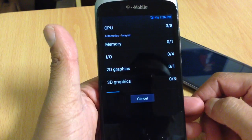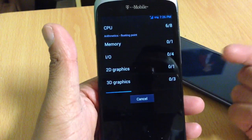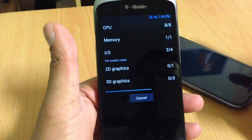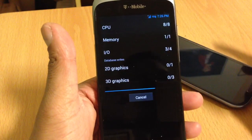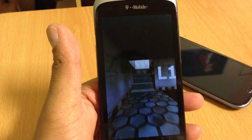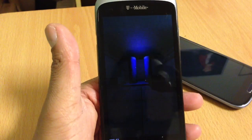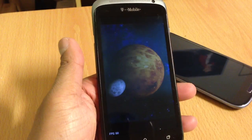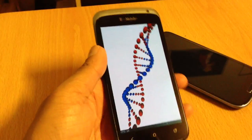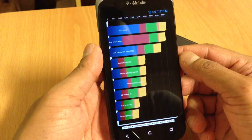This phone has the same S4 chip as the S3 but it comes with only 1GB of RAM — not 2GB like the US S3. This is the dual core 1.5GHz version. The international version comes with a quad core at 1.5 or 1.4GHz but also 1GB of RAM. With 4.2.2 Jelly Bean you really don't feel like it only has 1GB of RAM — it's working fast, flawless, beautiful. And it's running a nightly build, not even a stable release.